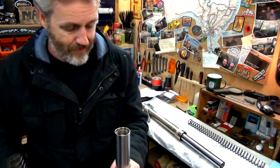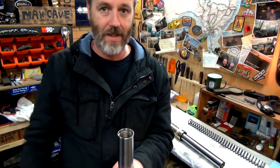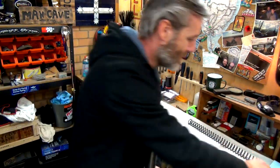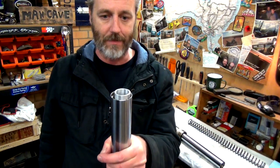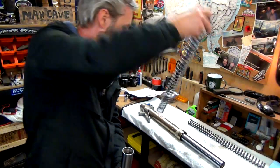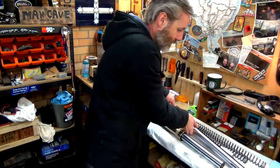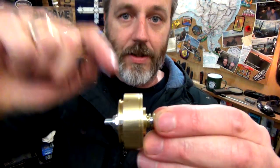Right, so now that that's in there, all you do is you get your spring, pop that in there. That is it. Pour your oil in, put your spacers and all your bits and pieces. Now, obviously, if you haven't had an emulator in there before, you're going to have to cut your spacer because now it's sitting up too high. So basically, if I get that back out, as I've said, I've got to cut that distance from that edge to that edge off that spacer, and that'll get me back to the way it was.